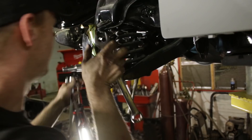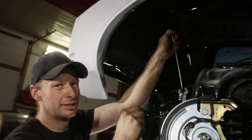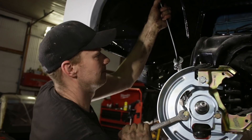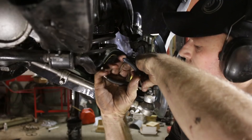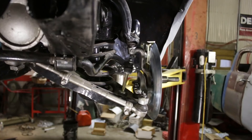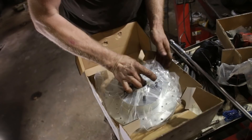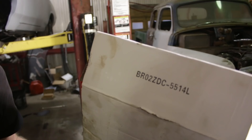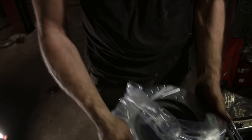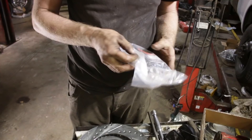Make sure to stick your hand in between the wrench and the steel because you don't want to scratch the steel — your hand will get better, your steel won't. We can put our tie rod back on now. There is a left and a right to the rotor because they are slotted and allow air to go through and spin around. If you look at your box, it will have a 5514L — the other one will be right. Right would be passenger side, left would be driver side. These already come with the races installed, so we need to install our bearings and our seals. You also have a cap with new cotter pins, washer, and castle nut. Make sure you've got the right seal.